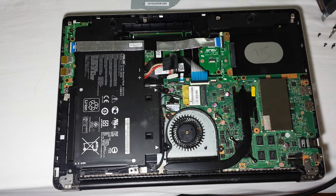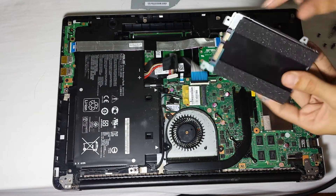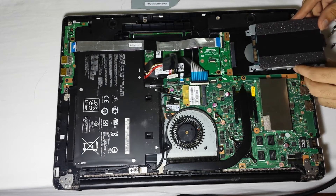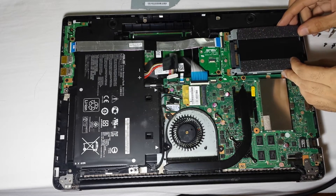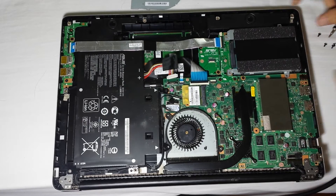This is your 500 GB Toshiba 5400 RPM hard drive. You could put an SSD in there in the future — just unscrew these two screws to fit it in. To put it back, the same process applies: gently place it down, push it in, and put the screws back in place.